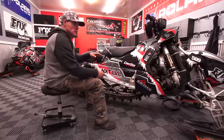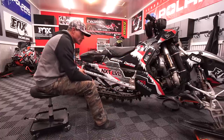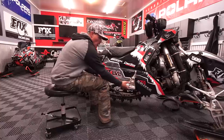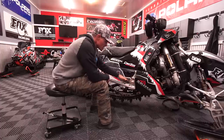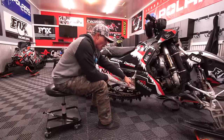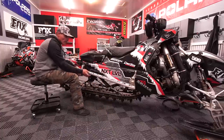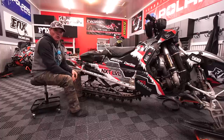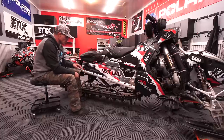Moving back on the snowmobile, checking your shock pressures, we'd also want to do that underneath in the rear skid. A visual inspection of all of the parts — we've got the stock running board here. Look for fatigue, bends, missing rivets, or cracking. Also back here where we've got the lower support, make sure those connections are all in good working order. Throw a socket and wrench on everything and make sure all of your suspension is tight.